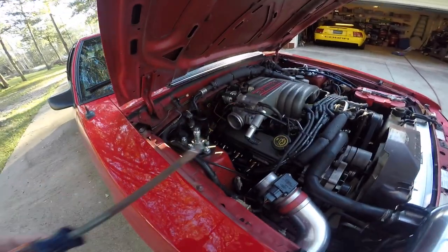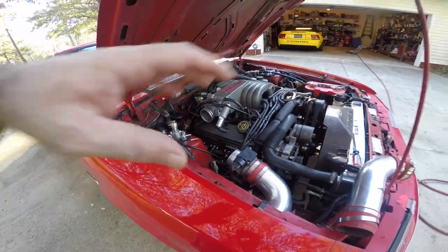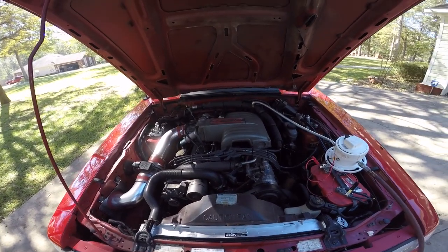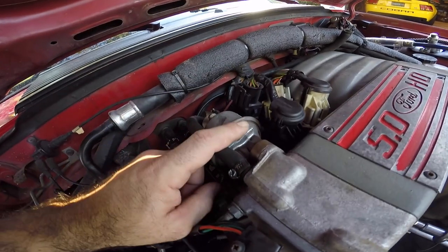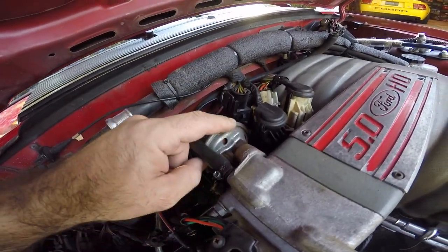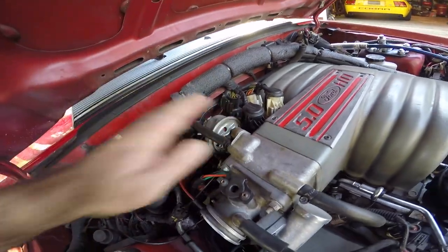So real quick, I want to talk about vacuum leaks. While we're here and we've done the Mr. Fusion build, we've smoke tested everything. What you guys didn't see is I went back to verify that the EGR was leaking, and it is. It's leaking out right around the back corner here, so that needs a block off.